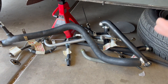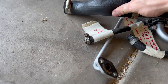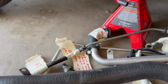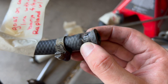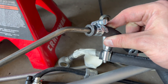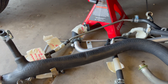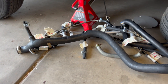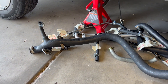After replacing all these hose clamps, some of my fears were confirmed. A few of these coolant lines really should be replaced. First off, this is the huge radiator hose here — for the most part it's in pretty good shape, still nice and soft, but you can see there's a crack in that hose, which is a bit concerning. We also have this return line hose that's just completely old, brittle, smashed from the old clamp. This piece right here actually snapped off — I had to cut it back, and honestly that does not look good at all. I'm gonna change that before we install it back in the car. So with all this in consideration, I think I'm gonna go ahead and order the DO88 coolant hose kit, which will completely swap all these hoses out with good high-quality DO88 stuff. I wasn't anticipating doing this, but it'll be a huge upgrade and I'm super excited for it. So I guess we'll do that in another video.